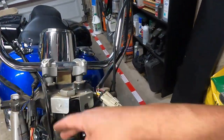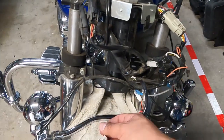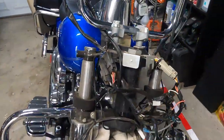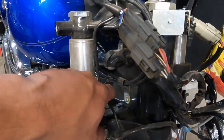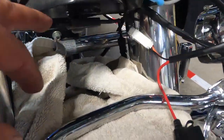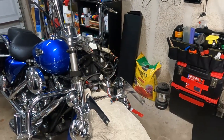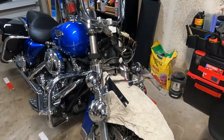Nacelle's off. I cut a zip tie or two. Marked off the auxiliary plugs — one for passing lights and one says aux. Looking through this now, I see why they gave me the additional brake line. What I thought was a coupler here is actually a solid piece. So the brake line goes all the way down to the bottom and then splits to the two lines that go down to the calipers. Unfortunately, that means I'm going to have to take all that apart and drain the brake fluid.